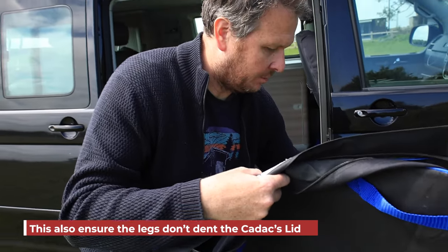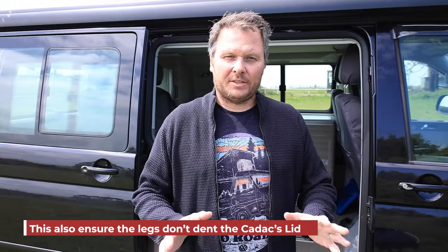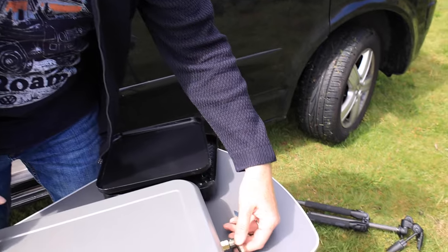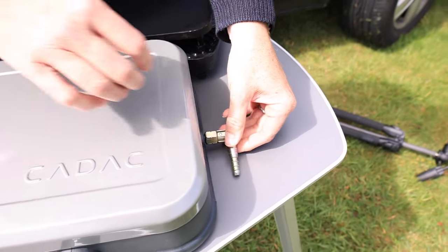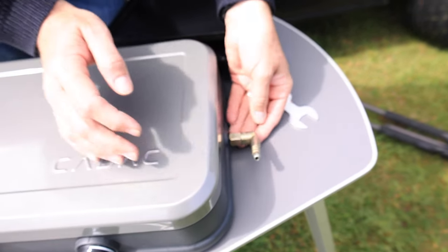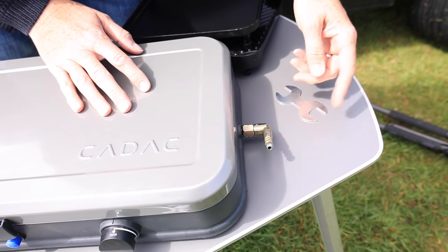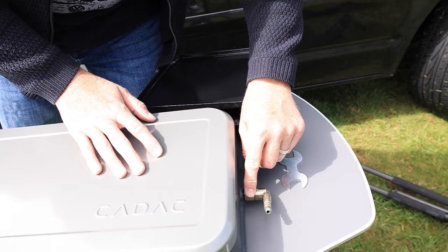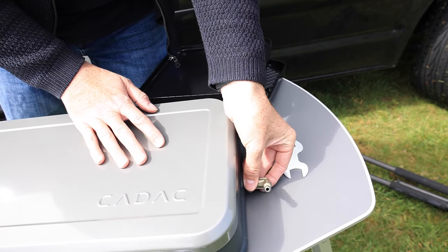This is a gas hob, so if you come and look down the side here, we can see it comes with — I think the new ones might come with a quick release connector — but this one came with a normal gas fitting where you put the pipe on. However, it does also come with a spanner. We've taken this off and replaced it with something else. Don't forget that this does have a reverse thread, so to undo it you have to turn it clockwise, so let's undo it now.